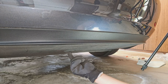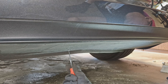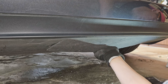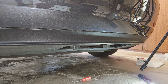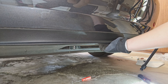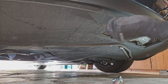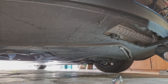Under the bumper there's an access panel. You can use a flathead or a 90-degree pick tool to move these little pins to the side, which will unlock them. Then we're just going to pull this down and unclip it. This is the access panel you might have on your Model 3 — that's what the tow hitch should be coming out of. If you don't have this access panel, you're going to have to cut a hole. If you look to the side of that, there are two tabs — just open them with the 90-degree pick tool.